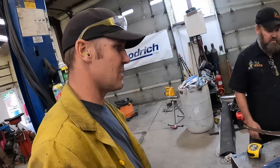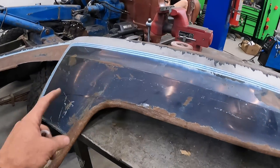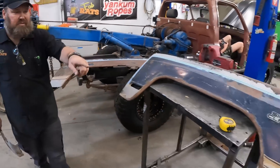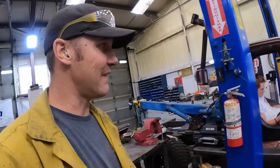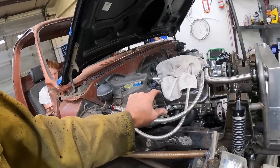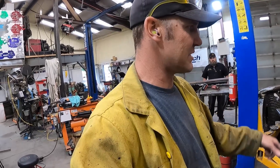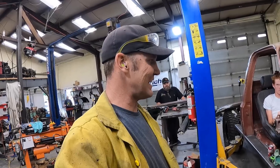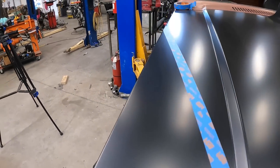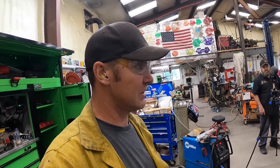Ben is tracing some artwork Paul made - he's trying to make this fender look like that fender. We've got to cut the bottom and the front, so here we go. I've got holes cut in the cab right through there - we're gonna run the fender pipe right up along there, angle over in to tie into that, and then the fenders will hook onto those. That way when we tip it on its side, some DOM tubing is keeping it from bending everything to death. All right, it's time to cut a hood - I'm gonna chop that blue line right down it, cut the other side, start building fenders, get them hooked up, and make this thing look like it needs to.